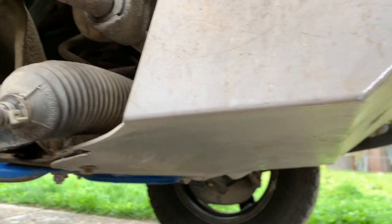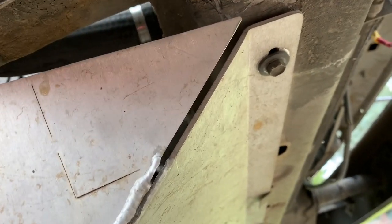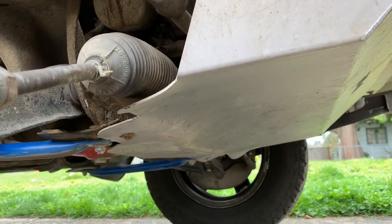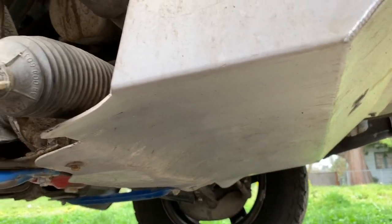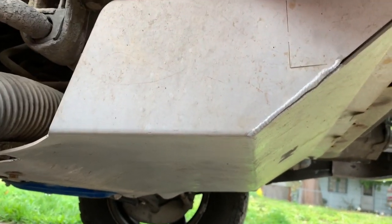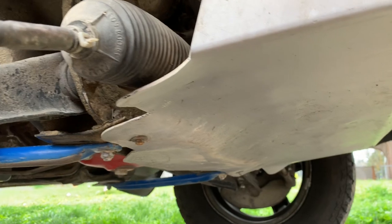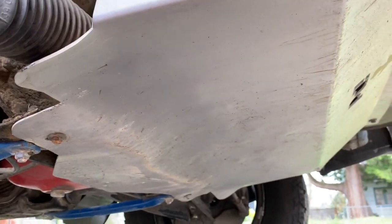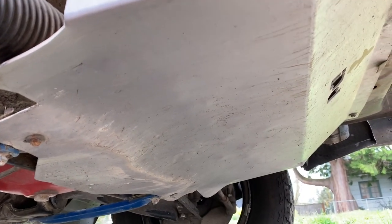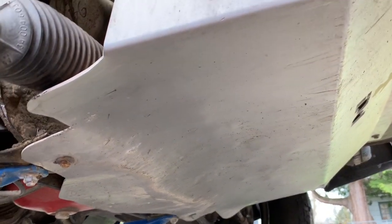As you can see, it's completely bent and it cracked the weld here — it wasn't even actually welded all the way up. I got it pretty much almost for cost. This thing works pretty well for mild off-road stuff, but once you get more crazy, I'm definitely going to need to move to like a custom steel pan or something like that. It just got absolutely destroyed. At one point it got pushed up into the steering rack to the point that the rack would just bind up — and that's not something you want. So I probably need a new skid.